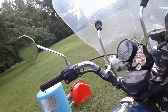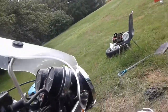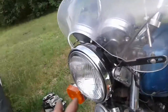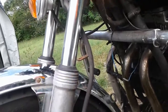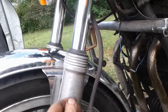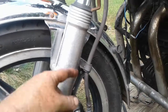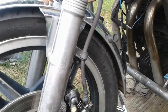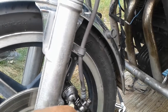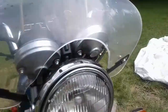Lights are hard on these charging systems on these old bikes. Yesterday I went to drain and flush the brake fluid and bleed it out — anybody who knows what a bleed screw looks like. I went to take the original out and it pulled the threads right out of the hole, so I had to tap and die, re-thread the hole, and jam a short bolt in there. It doesn't leak — she came right back up to pressure.